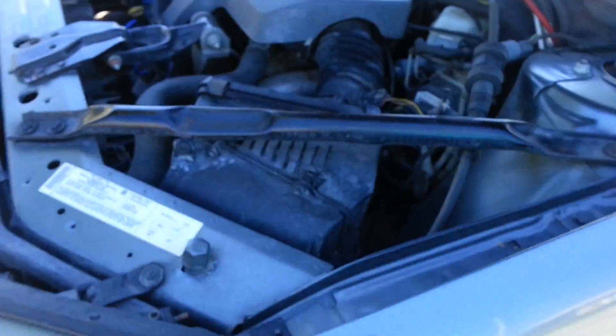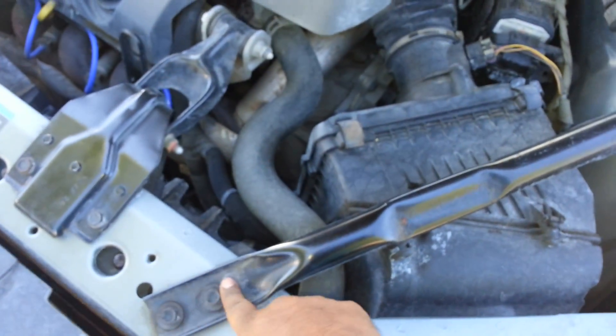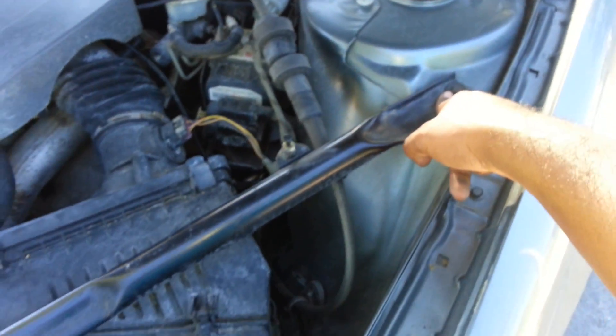Obviously we're going to have to go in and take off now. The one I bought - you want to keep your mass airflow sensor, so it's from here back just take out your air box. You've got to take this off here, so that's what I'm going to do next. Take off one, two, three bolts - not terribly hard to take off.